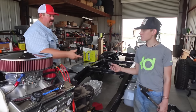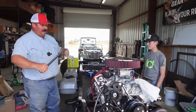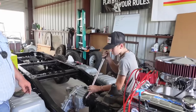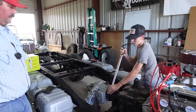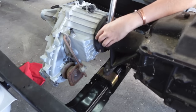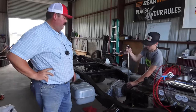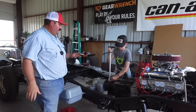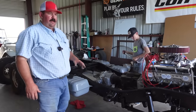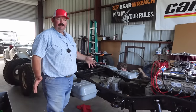You can set your torque wrench to a certain foot-pounds of torque setting, and then once you get there it'll click. That click you just heard is the torque wrench saying you've reached 40 foot-pounds of torque on that bolt and it stops. The reason we're going off of what General Motors specs show it's supposed to be is because if you tighten it too much you can break one of the housings, strip the bolts out, or strip the housing — and that's disastrous.